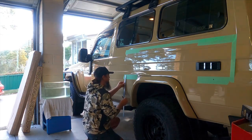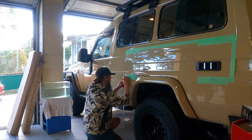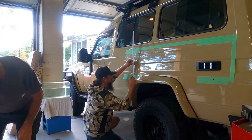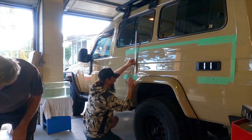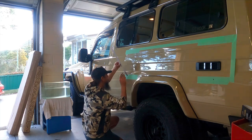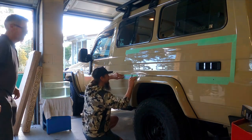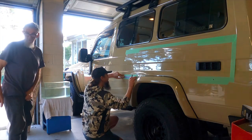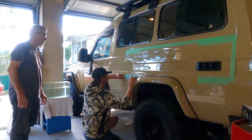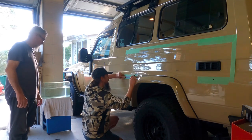And once you've got that rear end, what you need to do is mark down 25mm from that ridge line again. So do that front and rear on that masking tape. That'll give you a bit of a guideline as to the height. So once we get that rear bolt hole fitted to the Troopy, then basically the MaxTrax table holder will tell us where that hole is going to be. But if we can get the height right, then it should be pretty sweet for when we put the table on there and get it measured up.